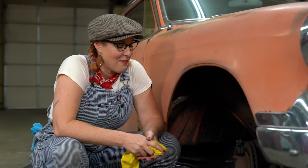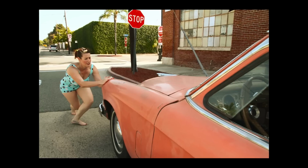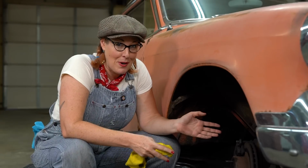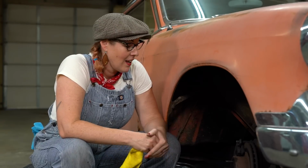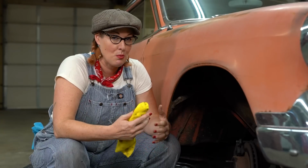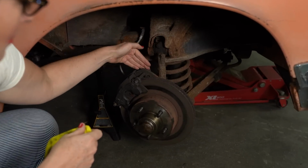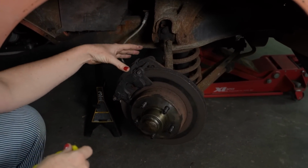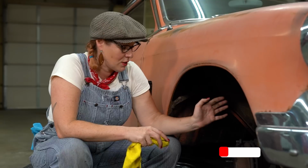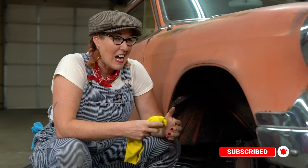Before Ethan came into my life, I actually upgraded the front disc brakes for the Studebaker. There's a funny story about me losing my brakes, which I'll get to later, but it showed me the importance of good front brakes. The kit I used is just one of those conversion kits. We wanted to go extra good with the truck, so we did a full-on front spindle connected to the suspension, but this one just gives me a bracket that connects to my existing kingpin setup, and then it uses Monte Carlo and Granada rotors and calipers. So definitely an upgrade, but not quite extra good.